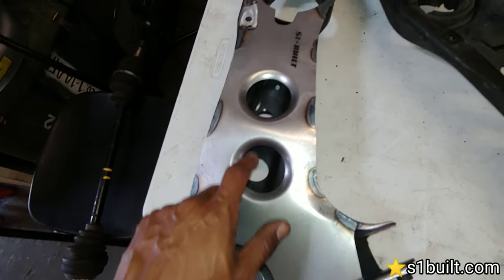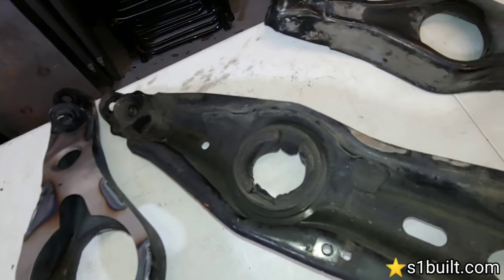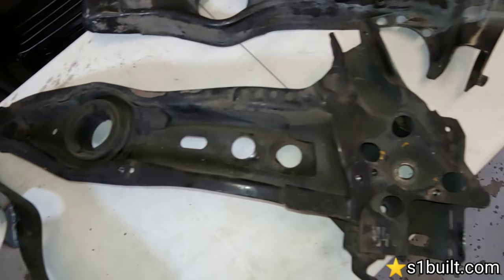This has a gusset plate — you can tell that the back of the stock arms is not braced or reinforced, and we've seen these crack before. So we have our gusset plate which we put on for bracing and straightening. This is how it looks when done — we're going to show you how to clamp it on and weld it in a minute.